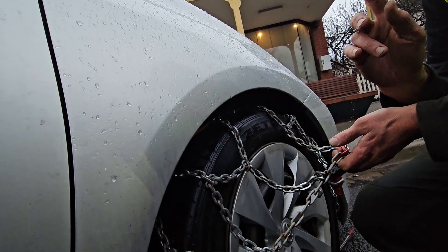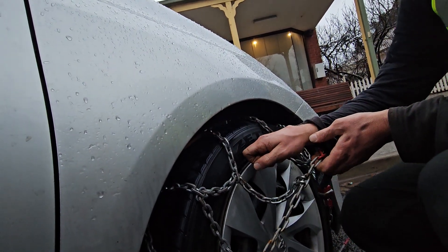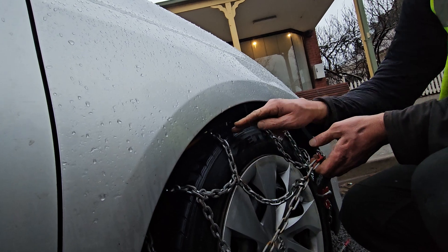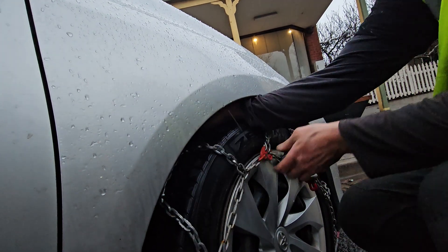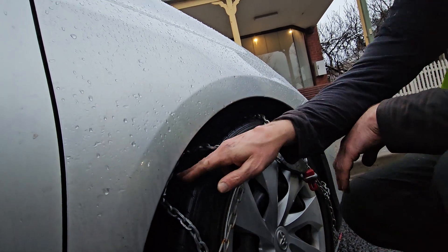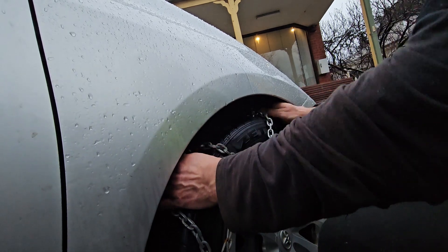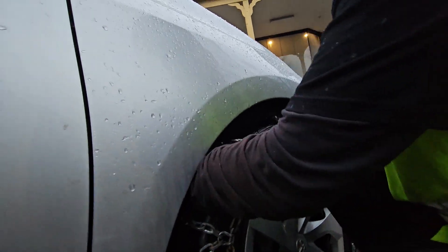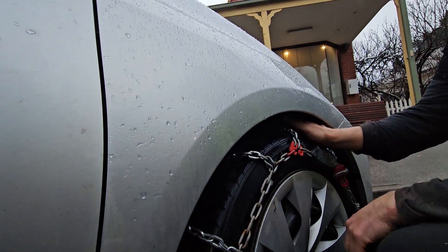This is the most important part. Being a plastic hoop, I want that plastic hoop to sit roughly where my knuckle is on the other side of the tyre — nowhere near the top of the tread. Push it over the back like this — no good. Grab the links here and a link here, and we work that up and over. Then with my fingers, I push down on the hoop to make sure it goes down as far as possible.